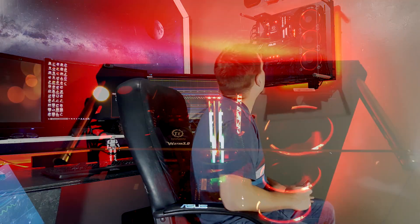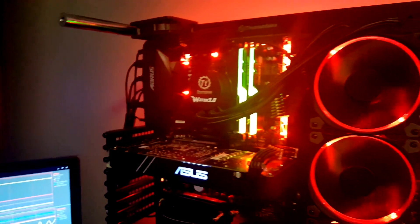And I actually installed it back here in my case. I moved the 8-pin CPU power over just a little bit, set it on top there with a little bit of double-sided tape, ran the cables, running a little bit of air over those VRMs. And lo and behold, the VRM temperatures came down to 60°C — a 30-degree difference. It was just a matter of minutes after plugging that in that I saw a huge drop.